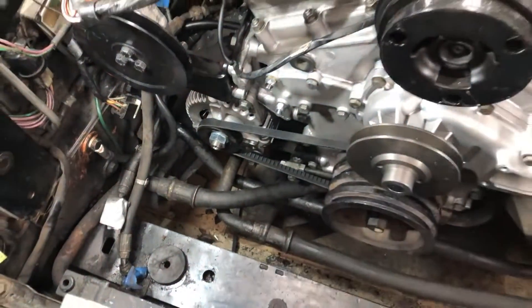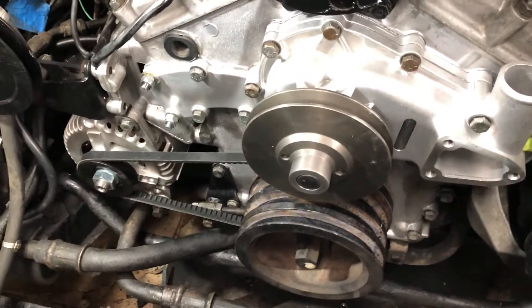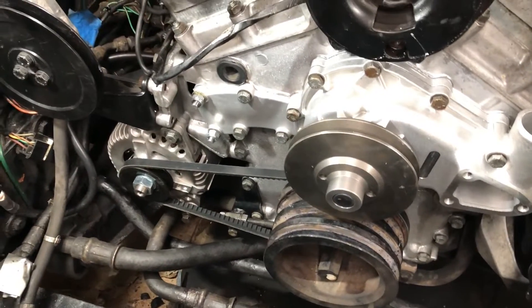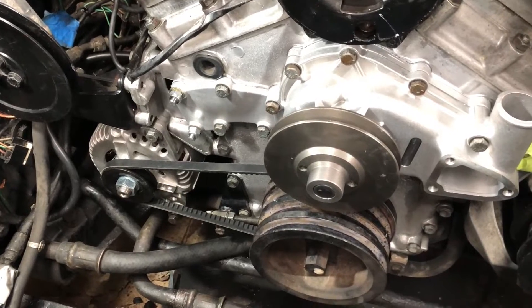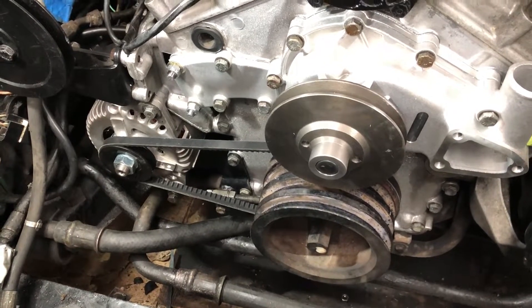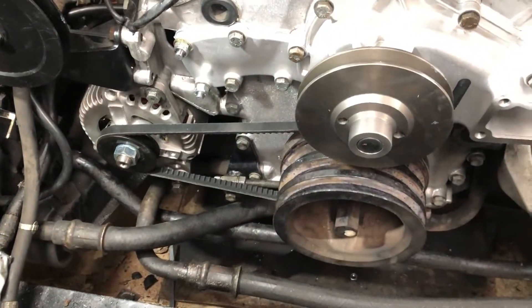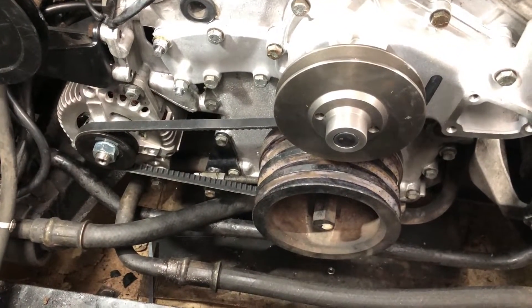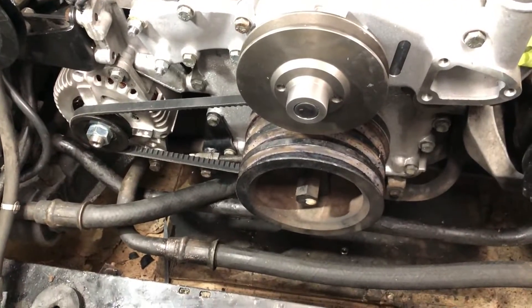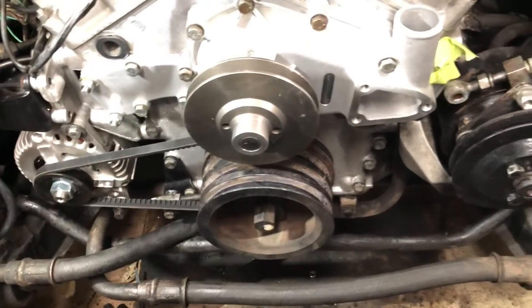New belt and we'll see if the alternator actually works and gives the output I need. It's an improvement over the original not only in the output of amperage but also in the working speed. That one spins up to 18,000 rpm whereas the original unit is only a 15,000 rpm limit. The pulley size is the same as the original, so if I need to put a smaller pulley on to get a faster spin, the alternator should cope with it — and that would hopefully give me more output at idle speeds if the fans are on, the lights are on, air conditioning running, that kind of thing.